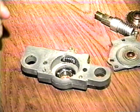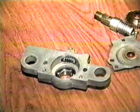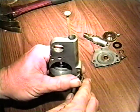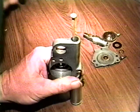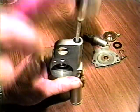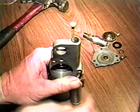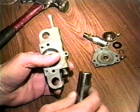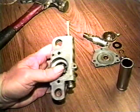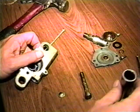With the transmission disconnected from the lock screw or nut and the driven gear removed, drive the worm gear and its bearing out through the end of the housing. We are using a blunted nail, but if you have a drift that is long enough to reach to the bottom of the hollow worm gear, it will certainly work. What you don't want to do is hammer on the end of the worm gear. Be sure to retrieve the end cap that will come out with the bearing.